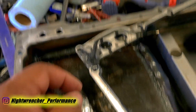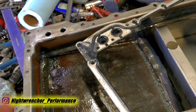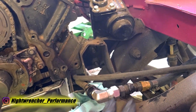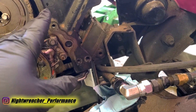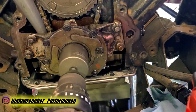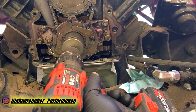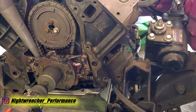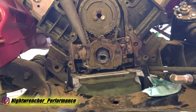I've got it somewhat close now. I'm swapping out the seal for one with a thicker silicone seal, bolting it back on, and hopefully this time I can get some oil pressure. All right, I've got it mostly back together — oil cooler lines hooked back up, bolts at the back of the pan installed, though not the front bolts yet, just to test pressure first. Let's try it. It's already looking way better. I'm going to disconnect the line going into the engine to see how much oil comes out — and it looks like that's all pretty good now. I'll put the front end back together and see if we can crank this guy over.